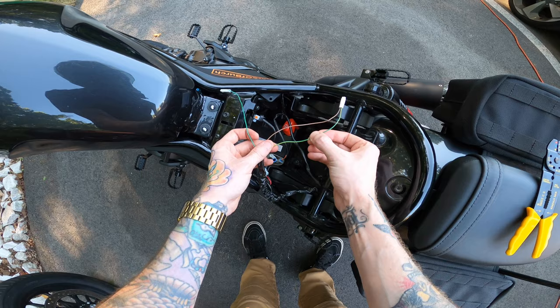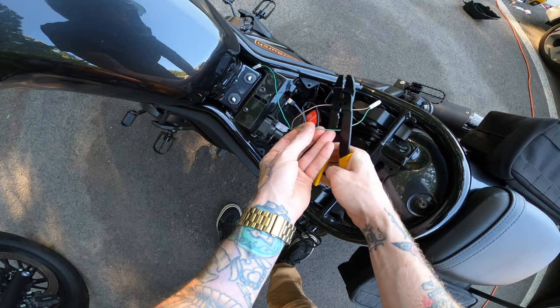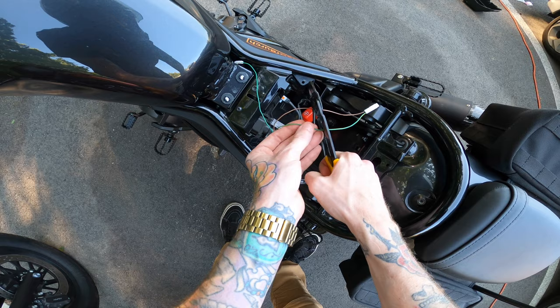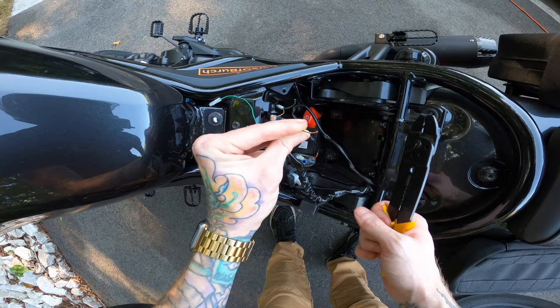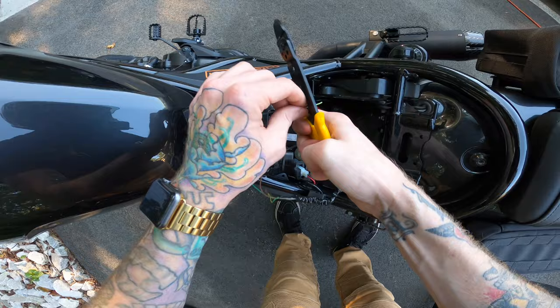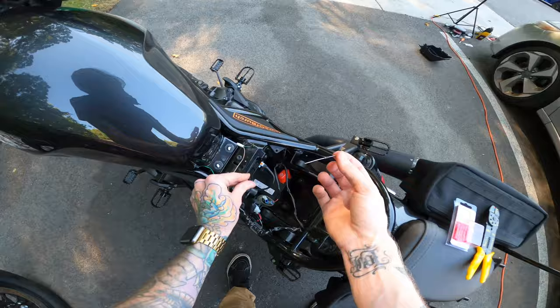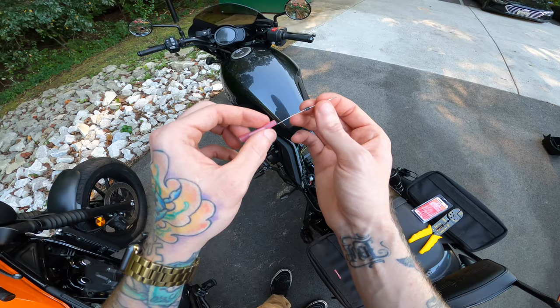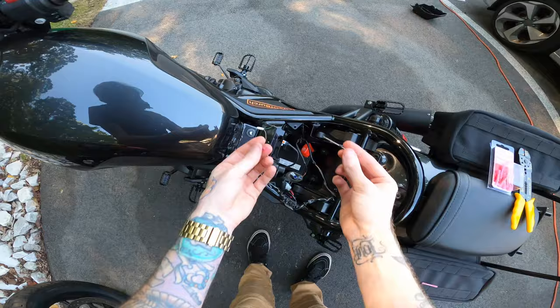Alright, we're using this green wire with the yellow stripe — not to be confused with the solid green wire over here. We'll take our wire cutters slash wire stripper and cut it pretty much in the middle of where I had it pulled back, so we have plenty of room on each side, and give it a quick snip. Then we'll use the 20 to 22 gauge stripper portion to strip it back about an inch. Then we'll do that with the other side behind the plug. Strip that off — shazam. So then we just grab our diode and wire it in line with that wire, with the gray portion of it facing towards the back of the bike and not towards the socket. They say to solder it, but I've never soldered anything in my life, so I'm using these weatherproof butt connectors just like when we did the tail light kit.